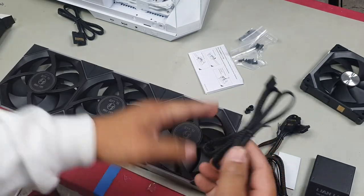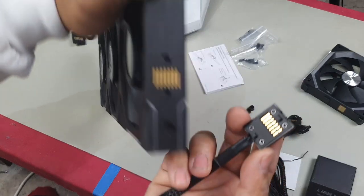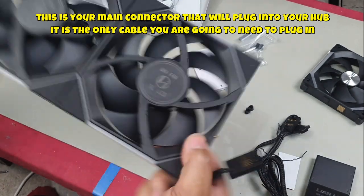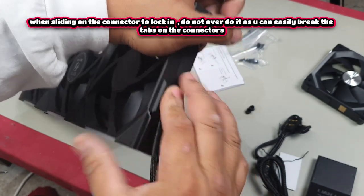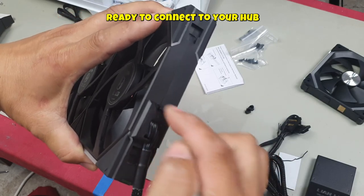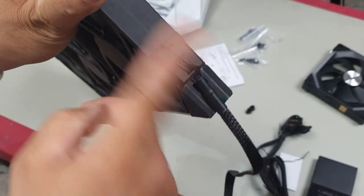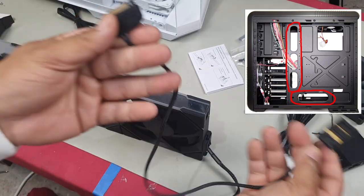This is how you connect the fan to the hub: you have the side that plugs into your hub and the side that connects to your fan. You only need one cable — they daisy chain and share power just like any other Uni fan. You've got a bigger tab on one side and a smaller one on the bottom. Line up the flat gold plates, sit it on top, and slide it down. You also have two cable slots so you can route cables either direction depending on which side is closer to your cable management hole.